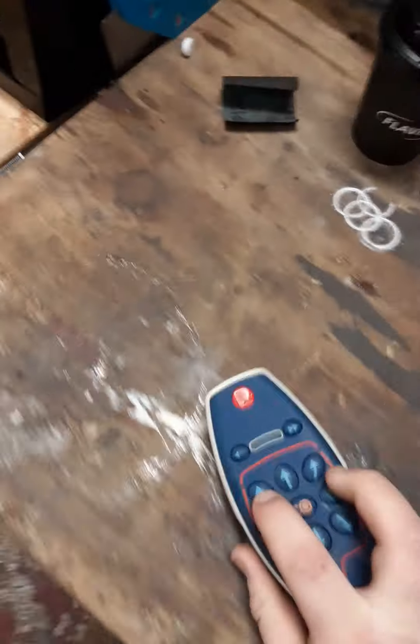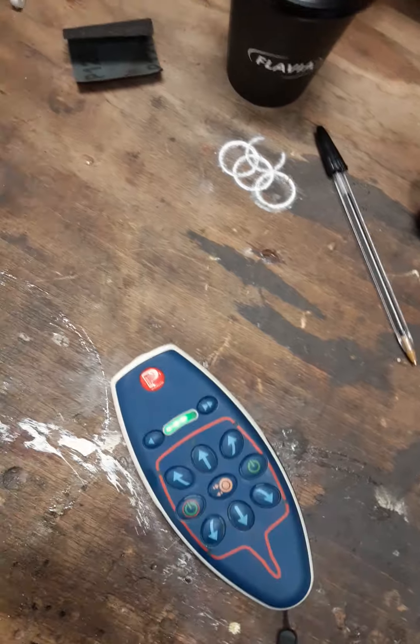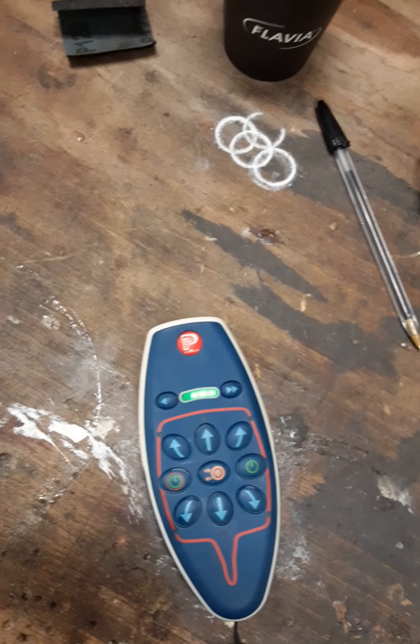Now onto the Power Touch mover. On this caravan you have a Power Touch motor mover fitted. Get your bar, put it on and engage it into the wheel — do both sides. We are then able to release the handbrake. Then turn your motor mover isolation switch — push it in and turn it backwards. On the controller, hold these two buttons in and it will do a connection cycle. Now we are connected to the box.